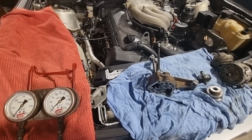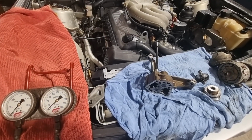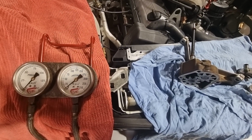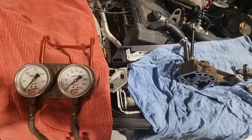Okay, I'm just doing a wee video now on priming oil pressure. Now, as you can see, I've fitted a gauge to the motor. Rebuild motor, always put a gauge on it. We need to know what's going on. Never trust in the oil light. It'll probably kick in at about 7 pound, and at that stage, pressure's pretty low.